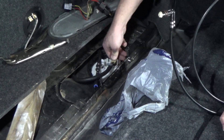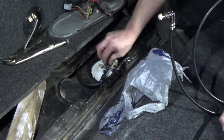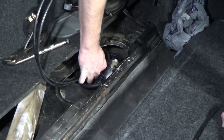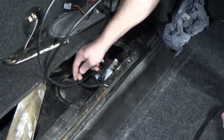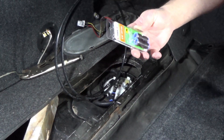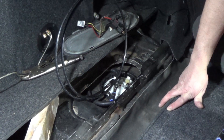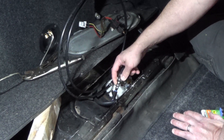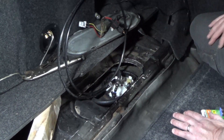That one goes in there, and then that one is going to be going here. Those two lines need to match up somehow. What I'm using is 5/16th fuel line press-fit unions — for the most part it's a quarter-inch coupler, push to fit. Works good. This is the supply side — I have a transition here that I created with a barb union, stubbed it to go onto the original supply line right there and it never had a leak from it.